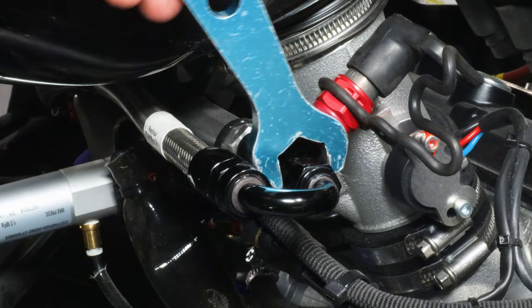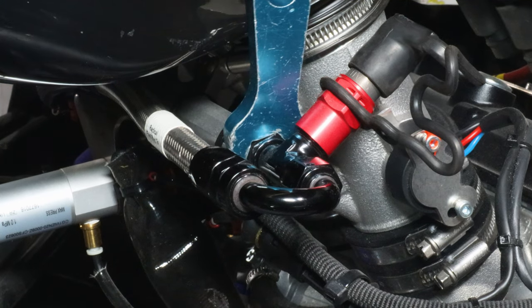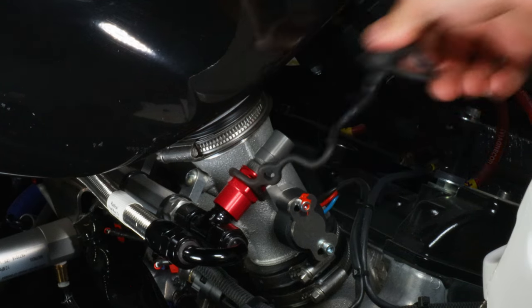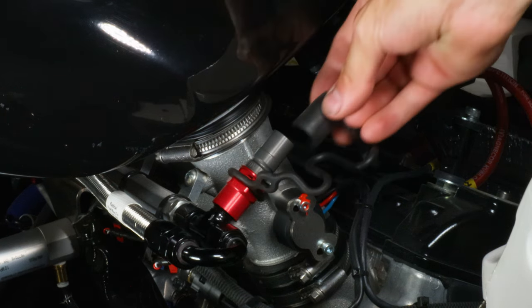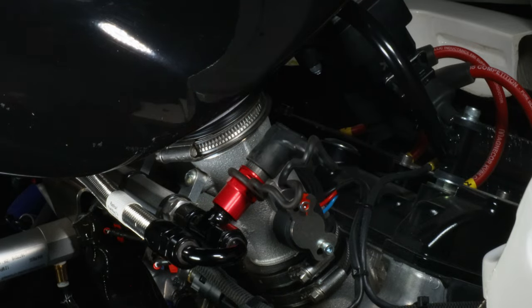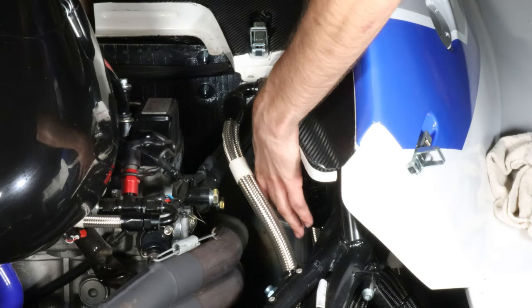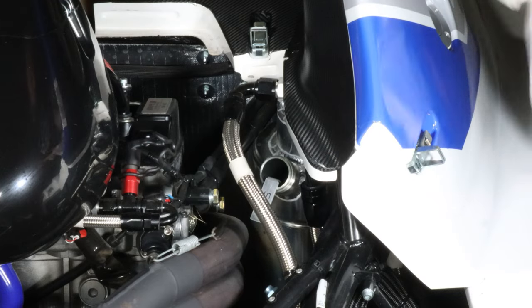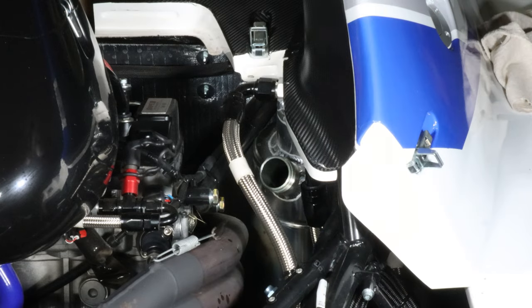Hopping out of the car, we will now move to the engine bay. You should bring your number 6 AN wrench and a flashlight. Begin by making sure the fuel rail is tight with the number 6 AN wrench. Then make sure the rubber nipple is there and secure. Notate in your comment area if it is missing or damaged. With the fuel lines safely checked, you will now do a cold check. Start by unscrewing the oil cap, then put the dipstick in, remove it, and check to make sure that the line is in between the two notches.